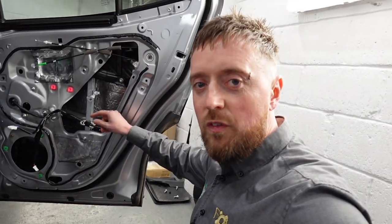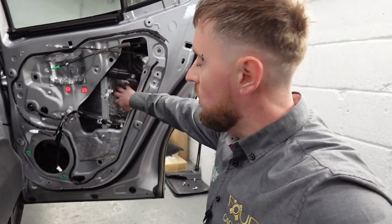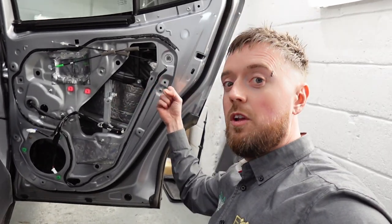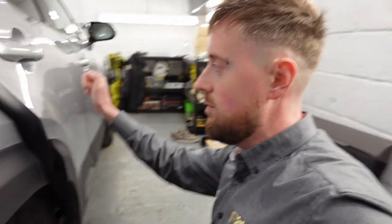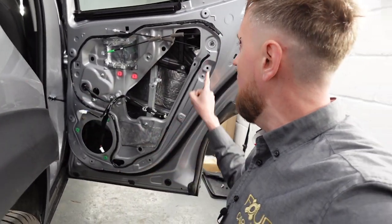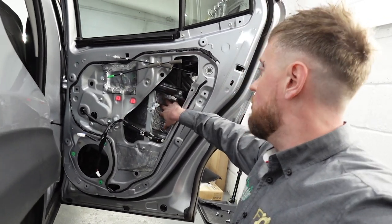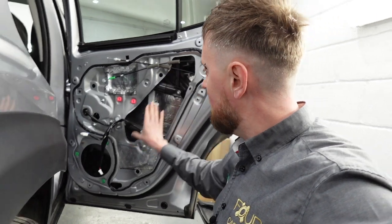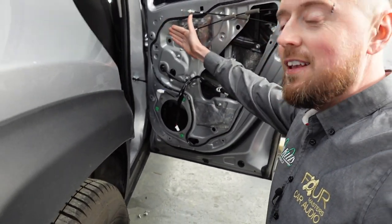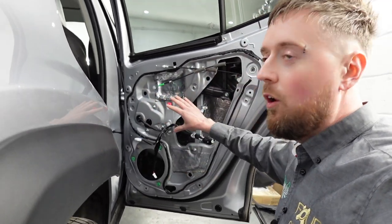What we've got with door soundproofing is we actually put four layers on. When we say four layers, we've got the outer skin — which is the painted side, the bit you would knock on the outside of the door. We then have the inner skin, which is what the door card mounts onto. We've done the outer skin fully. Some cars are trickier than others, like this one — your only access is through this hole here to get the soundproofing all the way up into there. That's time consuming because you've got to get your tools in through a small hole rather than a big open one.